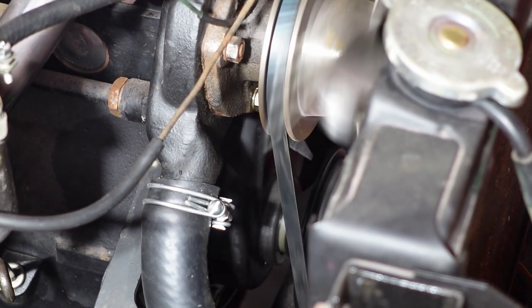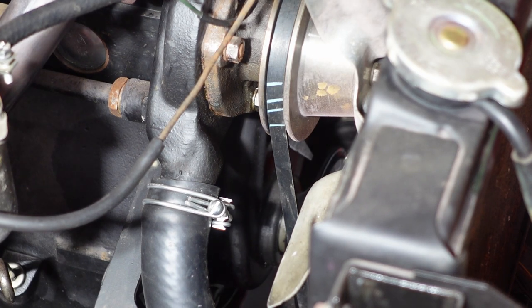So the timing might just be just a tick off. Now it's running bad again — there it goes. Whatever that kicked in right about then. I don't know what's causing that. I don't have a fuel delivery problem, it's not the plugs. I guess I'll put the electronic ignition module in next.